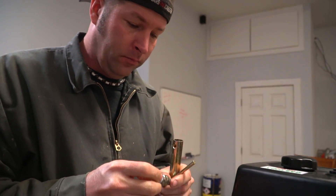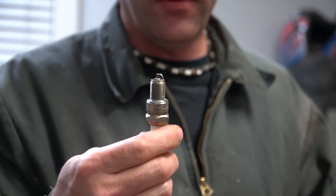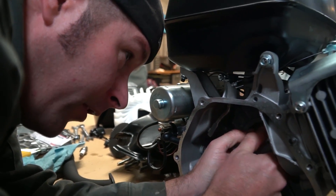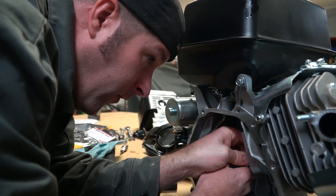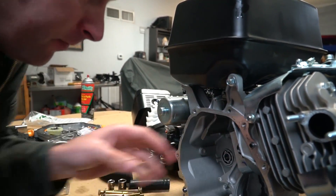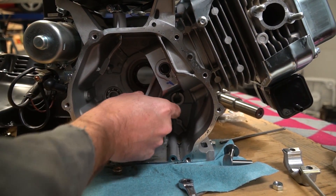How does it look? Making sure I didn't crack the thing. Good — you can tell it's been run, though. Now this will be interesting — we've done it before on other engines. Lots of times you have to pull the head off to replace the rod, but we're going to try to cheat. I like to pull the piston down far enough to get to the pin, remove the clip, pull out the pin, and remove the rod.